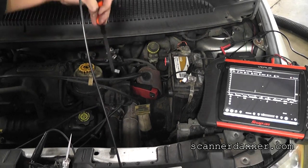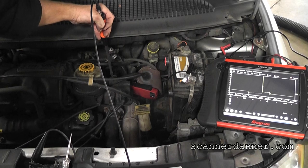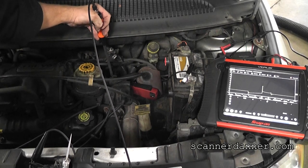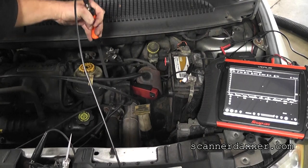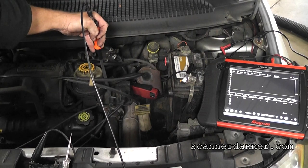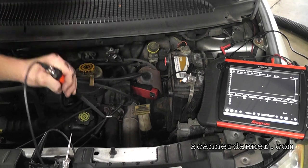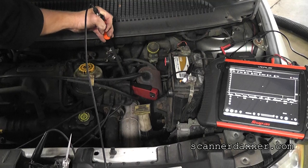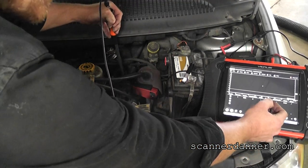Going to the back — this is its companion cylinder — and that test alone tells you your coil is bad. The fact that I have spark on the companion cylinder and do not on the front confirms it. There are variables — a short, for example — which is why we use the test light too. But this is a pretty quick test for identifying the issue.